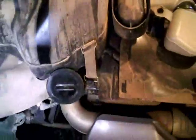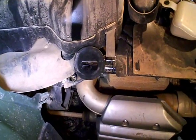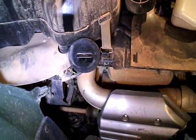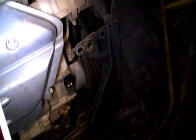The other thing, when I park the machine here, I shut the fuel off and I let it run itself out, and that way I won't have so much gas going on when I disconnect the fuel line. The other thing you can do if you didn't do that is shut the gas off, and actually the other side of the carburetor there's a drain screw.